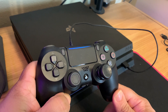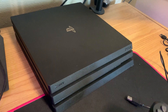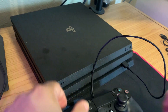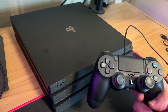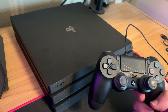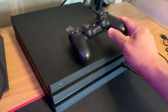If that still doesn't work, it might be a problem with the resolution, so you're going to go into safe mode. To do that, you'll need your PS4 controller and a USB cable that's compatible with the PS4. Go ahead and plug in your controller. Putting the PS4 into safe mode will give us some available options to try to fix it and get it working again.